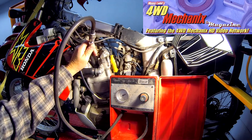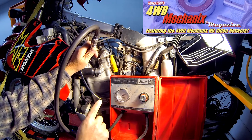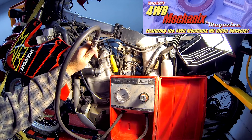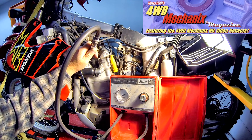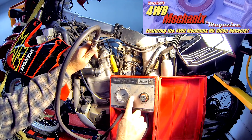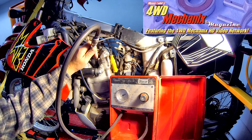In this case, the leak is 95% shown on the gauge. This means that 95% of the air going into that combustion chamber is leaking out of the engine — past the valves, past the piston rings, past the head gasket, or past a casting crack. We know we have a major problem, because the highest percentage of leakage I would want to see is around 20%, and an engine that is brand new and sealing properly should be more like 8 to 10% cylinder leak.